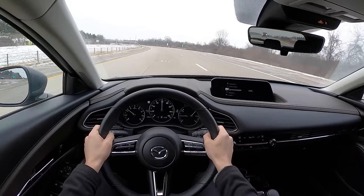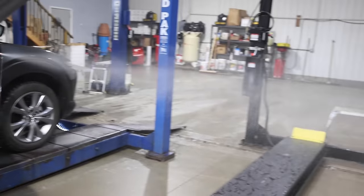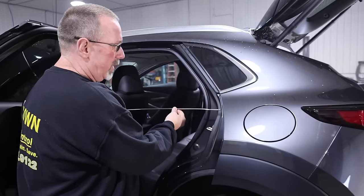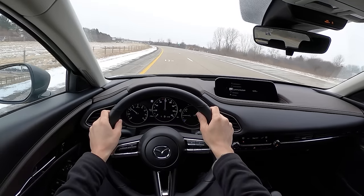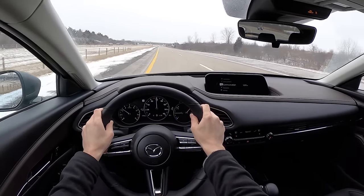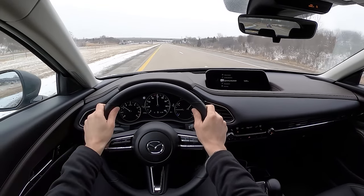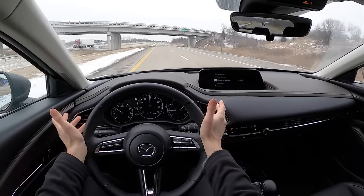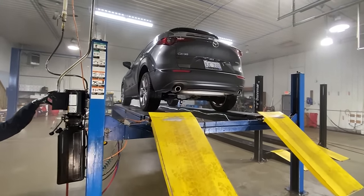A little bit of information about Crown. It is an oil-based rust coating, which means that it's very fine and it gets everywhere. They have these specialized sprayers that spray inside body panels. It works from the inside out, and Crown is able to get very deep into the chassis and the frame and stop rust basically where it will start. The oil is just a carrier for the rust inhibitor, which lasts about 14 months. And in my experience, this is kind of the best solution out there for rust-proofing vehicles, both new and old.